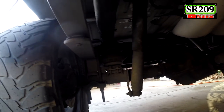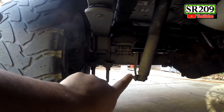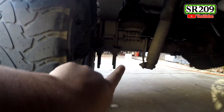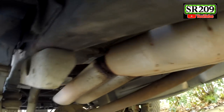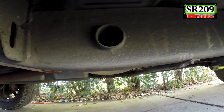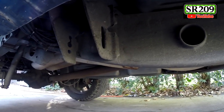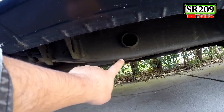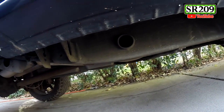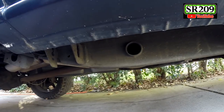As you guys know, the traction bars help with axle wrap. I figured out that the perfect spot is right in here, right underneath that bracket where my airbags are — between the shock mounts and the U-bolts. As far as where they end, typically on an extended cab Silverado like this, I've heard it's typically about 5 feet. However, I don't want them to go very much past this curve right here. I feel like right in this area is possibly the best spot to mount them. I'm going to measure from here straight to the back and see exactly what that measurement is.